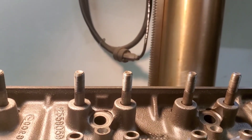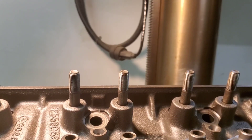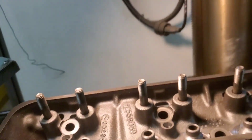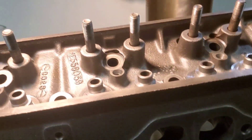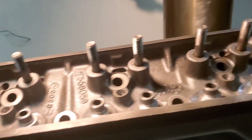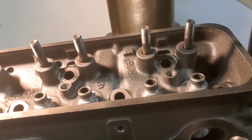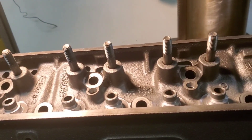There you have it. Failure to do this can result in camshaft failure, bent push rods, and all kinds of valve train problems — you can't have any binding. I will come back off camera and where I machined the top of these guides, I will put a slight chamfer and break that corner on all the guides. The guides in these heads were very nice — they do not need to be replaced. We'll come back when we do the three-angle valve job. I appreciate you watching as always. Don't forget to like and subscribe. If you have a question or want to see something, don't hesitate to ask. I know I haven't posted anything in a while — I've had some things going on. We'll have more on these Vortec heads. Thank you.